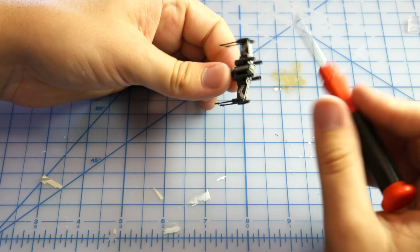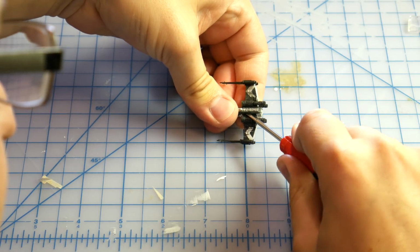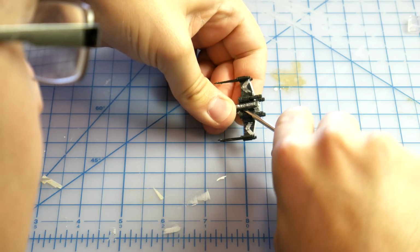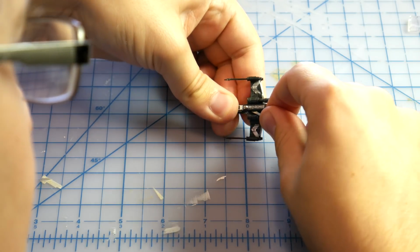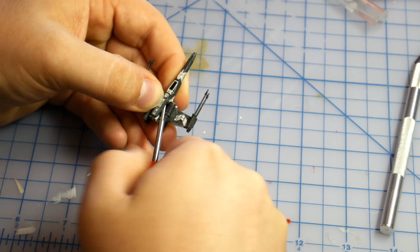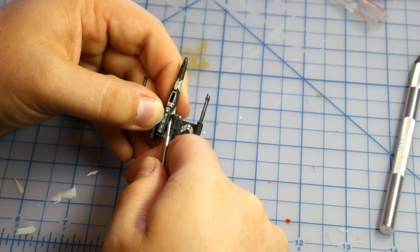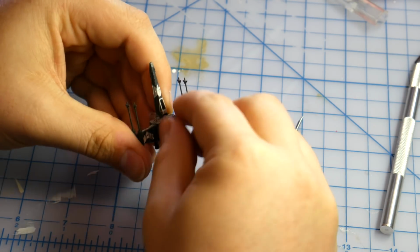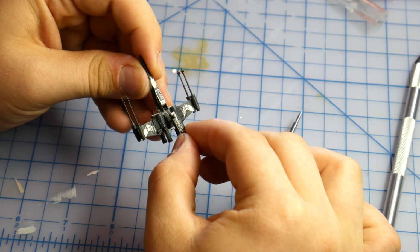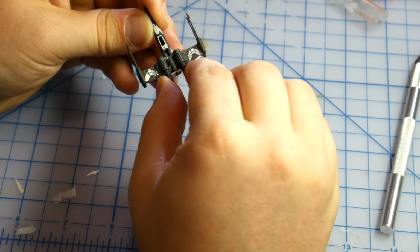Use your screwdriver with the engines as a fulcrum to pry the top of the piece off the model. Often, the astromech part of the assembly can be more difficult to separate, so work methodically in order to avoid snapping it off the model. You will start to notice the silicone glue stringing the piece to the model as it comes off. When it separates entirely, you can grab it with your fingers or a pair of needle nose pliers and pull it off until the glue strings snap.